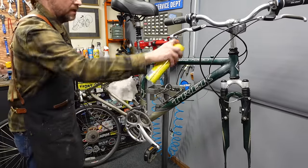This is just kind of a normal spot, but right there you can see there's a dent in the rim — it's actually right at the seam. You can push the reflector out of the way. Yeah, this is a tricky one and it's very temperamental. So this spoke is really loose. You'll get to a point where this one's loose and this one's tight, so it's going to be as good as it gets. There's just no more adjustability, but we should be able to get it so it doesn't rub and you won't feel it when you're braking. It's nothing too serious — not in need of replacement or any kind of expensive fix. Good enough for who it's for.